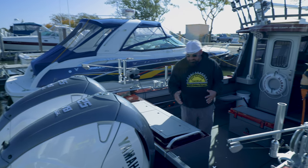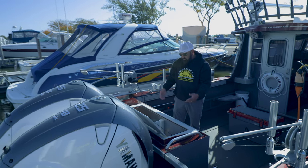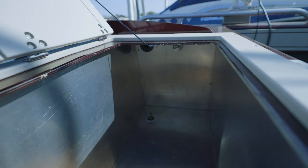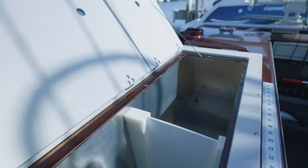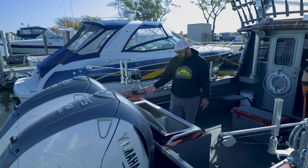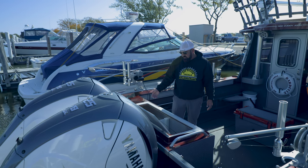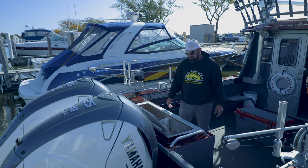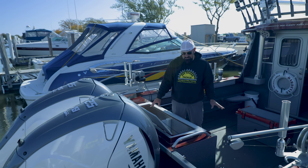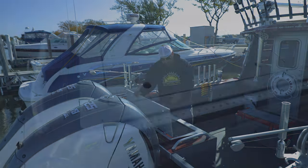We've got a live well here. We had Reed put a baffle in it — it's just shy of 60 inches long and about 18 to 22 inches deep, an absolutely monstrous live well. During summer I put freezer blocks on the bottom, dry ice blocks from Arctic Ice, and about 40 pounds of ice — that keeps us good for an entire eight-hour day. This was also converted at the factory as an option to function as a live well, so it has a live well feed and drain.